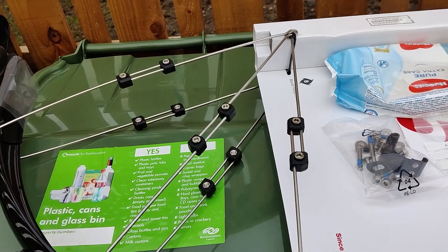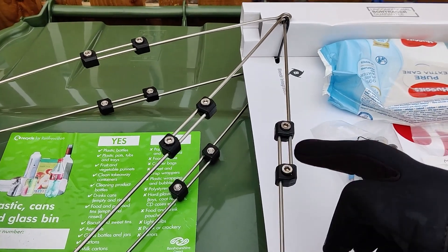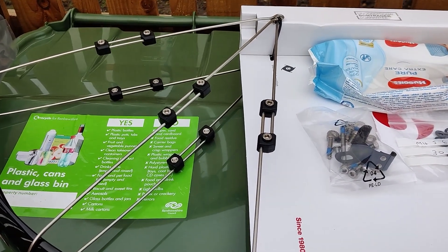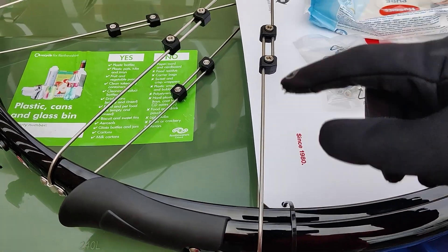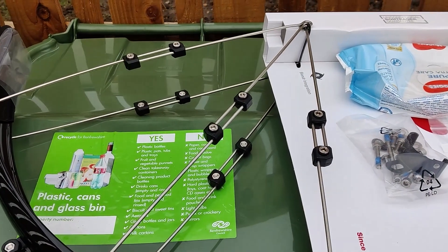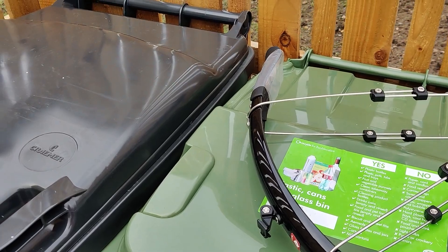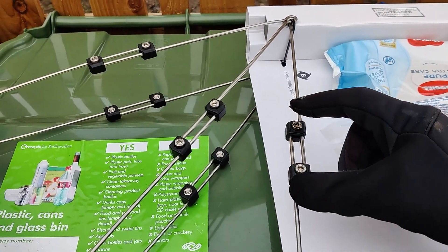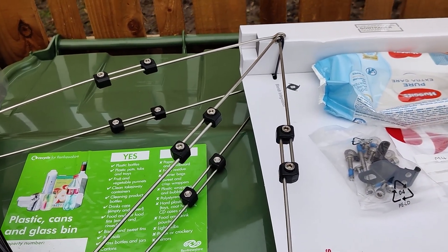The reason I bought these ones — I'd watched a few reviews on them and they looked pretty good. But the main thing that I liked was this bit here. I've fitted mudguards before and it was a real pain in the neck. You have SKS chromoplastic ones and what you had to do is cut the stay — measure it from the mount on the bike, cut it to size, then feed it through and put a cap on it. It was a real faff. I'm sure if you're doing it all the time it would be much easier. This thing here doesn't look as nice, but it looks super convenient and it should make fitting these a little bit easier.